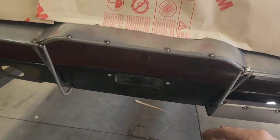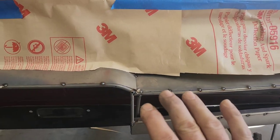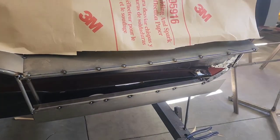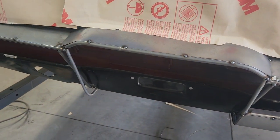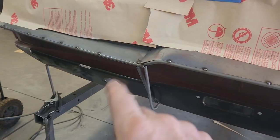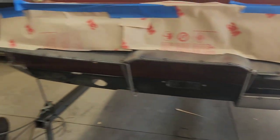All I'm doing is taking pieces of lightweight sheet metal and cutting them after I cut paper patterns, tacking everything up and making my general shapes as to where I want to go - how it's going to tuck under and how I'm going to allow for everything. I'm correcting angles as I go based on what it looks like from the side. It's a hunt-and-peck method. I'm using 3/8" DOM tubing to create areas where I'll have radiuses, so it's a kind of skeleton as I go.